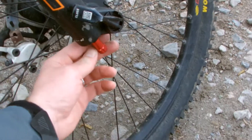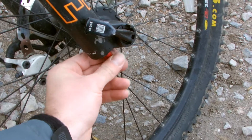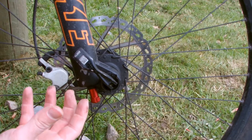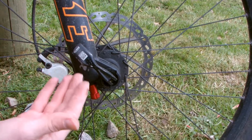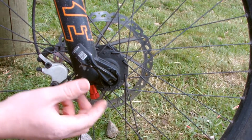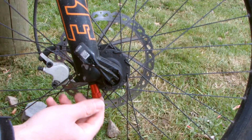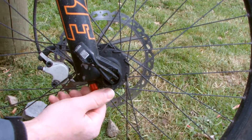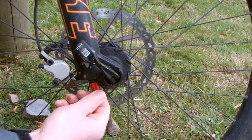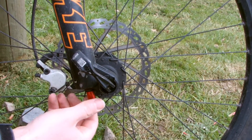You can soften it up a little bit with the rebound. If you're not taking obstacle after obstacle, it doesn't need to return so quickly. It's not quite simple harmonic motion because there's actually a different restoring force pushing it back to its equilibrium position. Here I can change the rebound — there's a spring in here which I can make faster or slower to return. If I turn it this way, it's a slower rebound — I've made the spring less stiff. If I turn it this way, I've increased the stiffness of the spring and the suspension recoils faster.